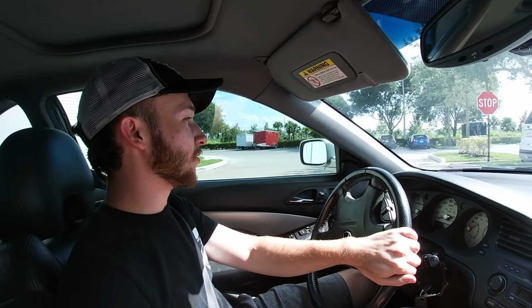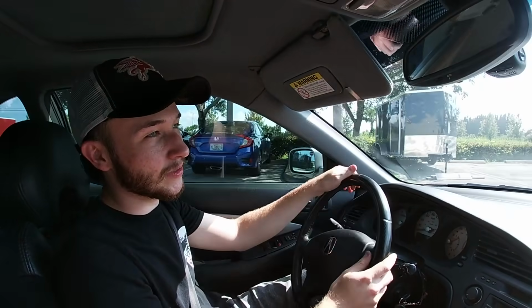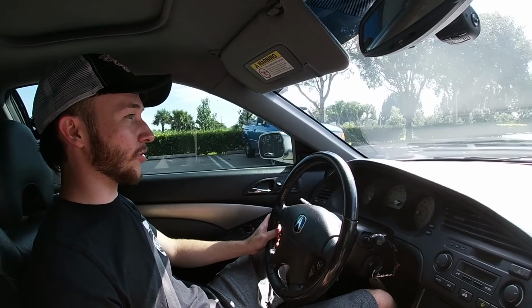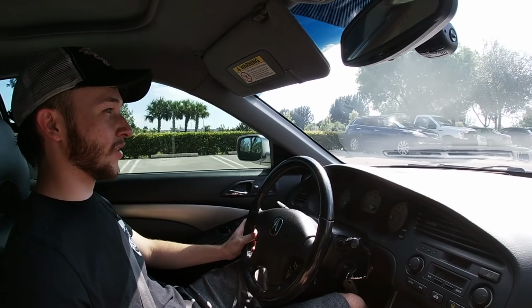All right, so it's the next day, and we're going to the junkyard to pick up some parts for the LS E36. What are we doing? All right, so I know the trick that there's a certain Mercedes fan that's low profile and super high CFMs. I found a forum post of someone that bolted it onto an E36 radiator with some brackets that he made. So we basically have to get this fan and get some brackets in. It'll look stockish. And it'll cool at idle.